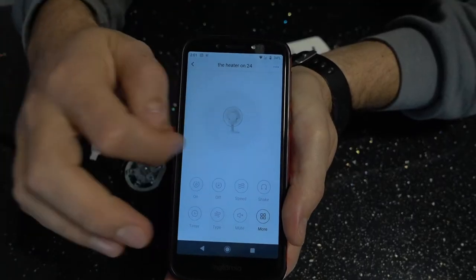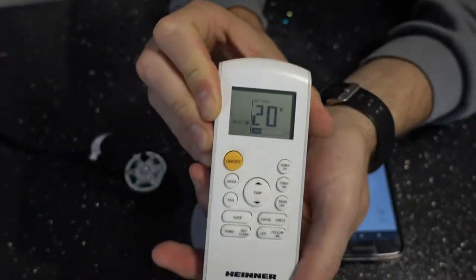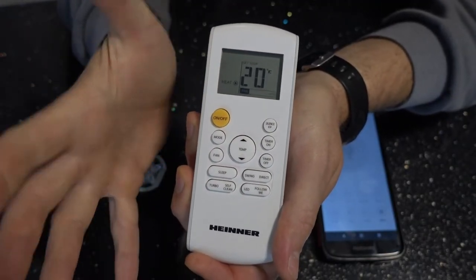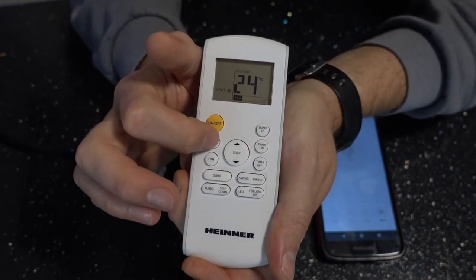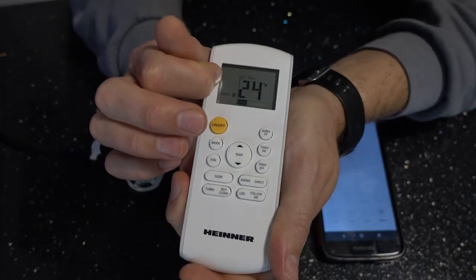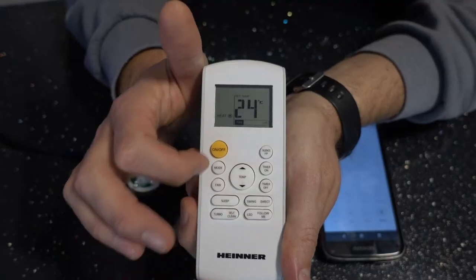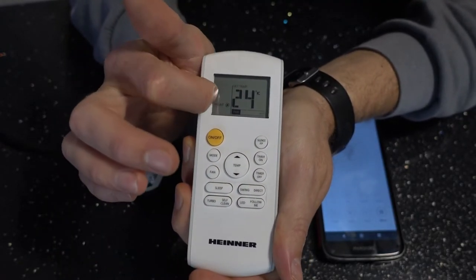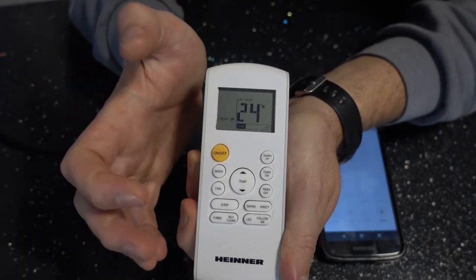You can learn the buttons, but before you learn the buttons, you have to program the remote — and this is very important. This remote is a dumb remote: you pre-program it before you turn the device on. I'm going to set the temperature to 24 and choose the mode — in my case it's going to be heat, but you could have it on auto or any other function — and set the fan speed. All these options need to be programmed, and the remote will generate a code based on the temperature and mode when you push the on button. That code is generated once, and you have to learn that particular code.